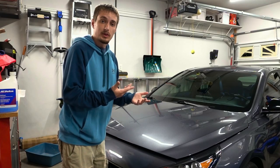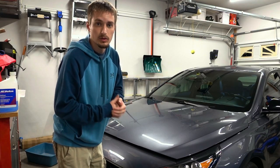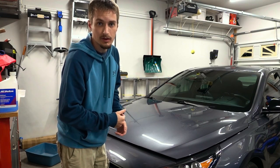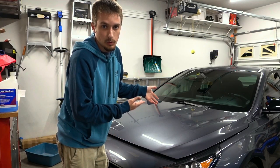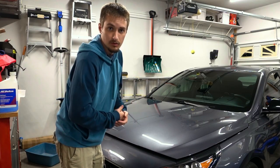After doing a little bit of research online, I knew we would have to remove the airbag and the steering wheel. The first thing you want to do is disconnect the negative terminal on the battery and let it drain down so there's no energy left in the system to ignite the airbag that you'll be removing from the car. So let's go ahead and do that, and then we'll jump inside the vehicle.